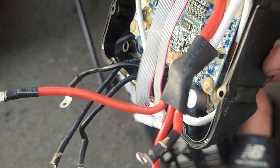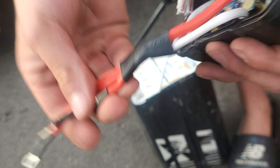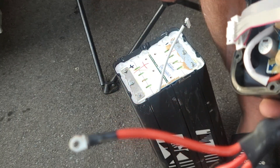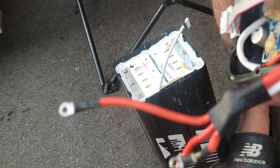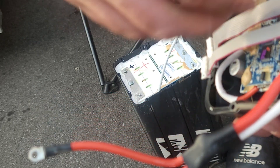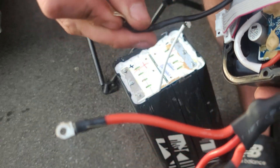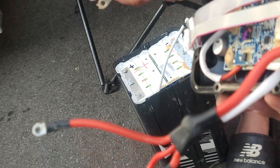What I'm going to do is take this single wire that goes right to the charging port — there's my positive and negative on my charging point. The positives are going to stay the same. I'm going to take this negative and crimp onto it, and add three new wires just like this — or I could cut these ones and crimp them on.